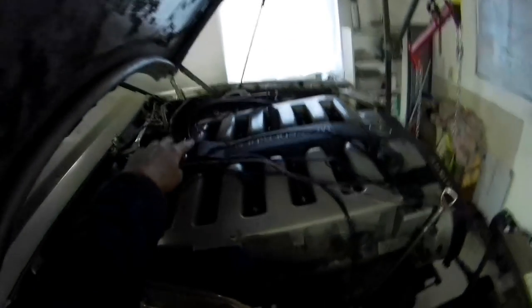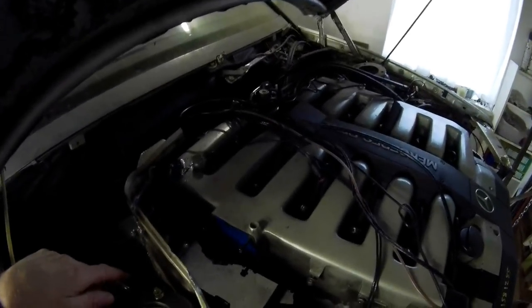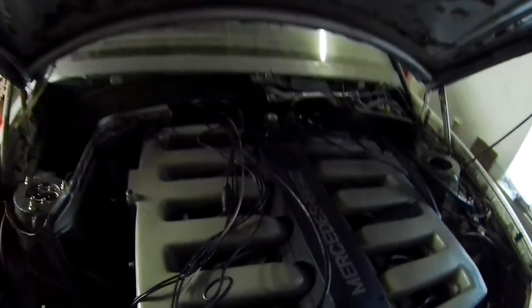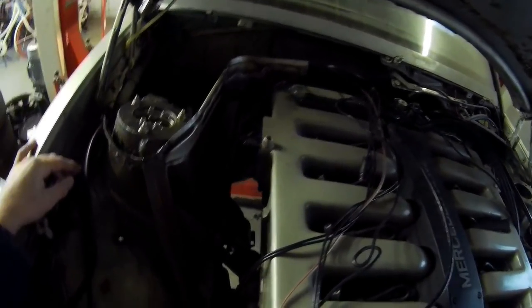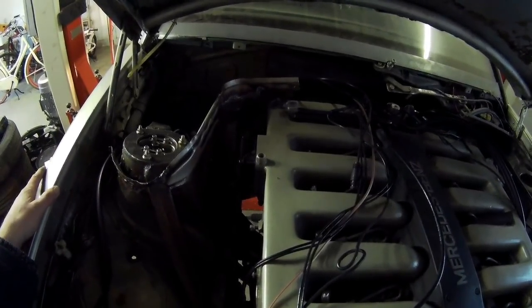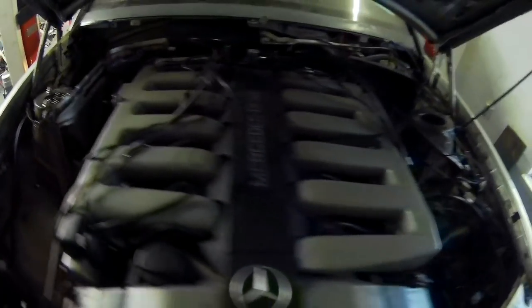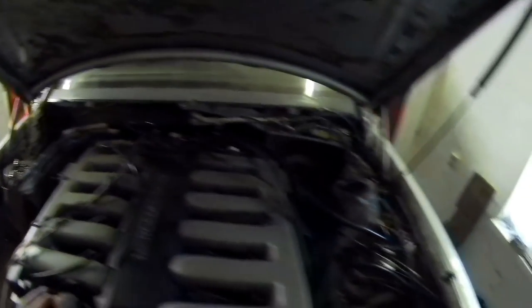There's also not enough space to the hood to fit a thick beam over it. If I mount it more to the back, it would go over where the engine harness exits — and I don't want to block that. If I go too far to the front, the hood angle drops and there's no space. So I think I'll just weld a beam underneath in the stiff frame. On the other side it's all done and welded in — there's more space there because there's no chassis number plate.